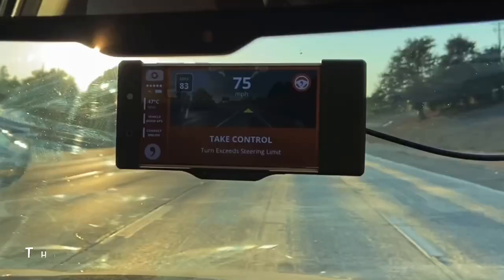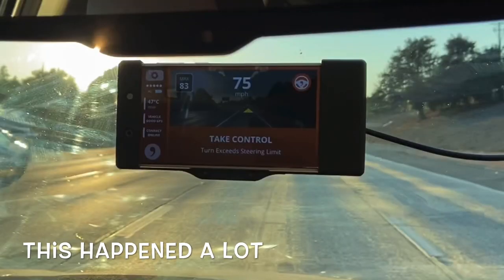So after testing open pilot on this 2015 Honda CR-V, the results weren't that impressive. It does do lane keeping in straight distances really well, but any amount of turning that's harsh or severe, the car isn't able to physically turn the wheel enough to compensate for that. I recommend if you have a newer car, this system might be worth it — definitely check it out. But if you have an older car and there's a torque limit on the wheel, you might want to skip this system. Anyway guys, thank you so much for watching and we'll talk to you next time. Peace out.